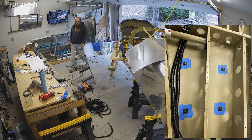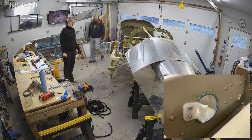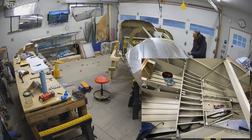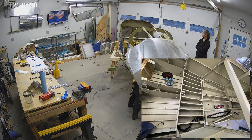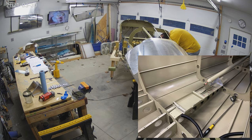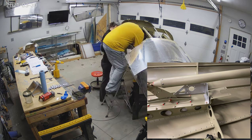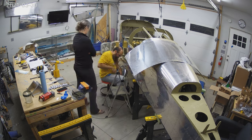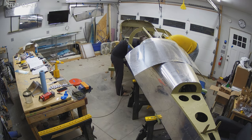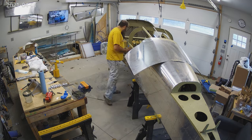I'm putting a lot of that conduit in because the floor pans for the baggage area in the back and also the rear seats get riveted on, and that's the main spot you're going to run wires - the battery wires for the battery that's in the back of this airplane, plus all the electronics and power for the avionics in the back, communications for the avionics, and two autopilot servos. In addition, probably the transponder, a bunch of antennas going through the fuselage floor in the back, lights back in the tail, and the static port is in the back there.